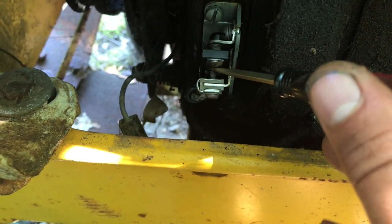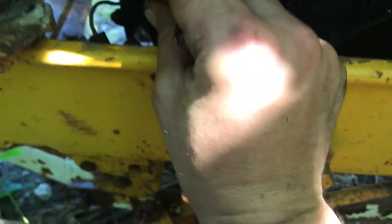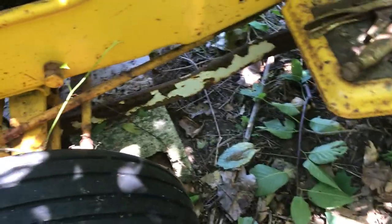A bit of corrosion on the bottom of this cover here, it's not grease, it's rust. But I'm not too concerned about that, because these points are looking pretty good. But you can see the rubbing block has a gap between the stop there, so I'll break these loose here, so every time that breaks, it makes contact. So I got a little piece of like 220, something like that, and all I'm gonna do is just pop it in between and see if I can do this one hand like a boss.